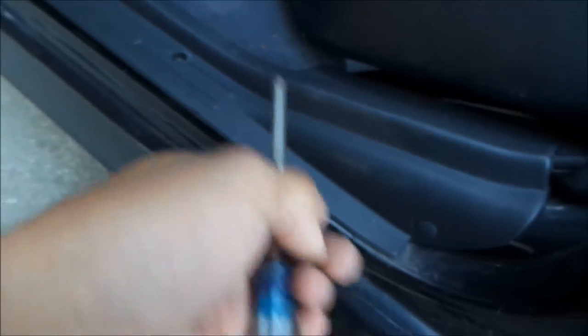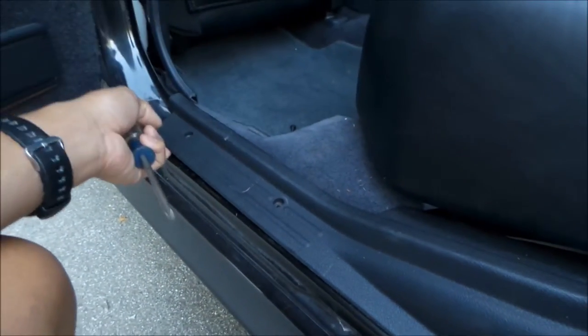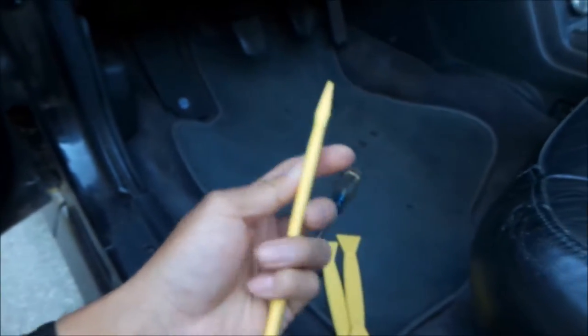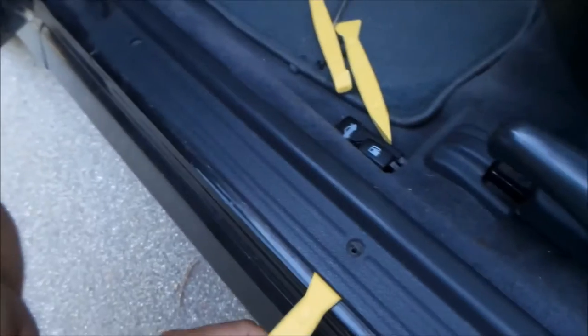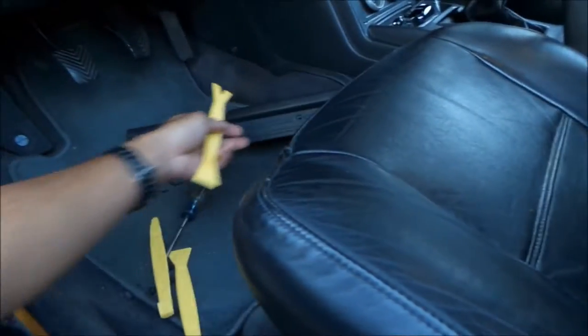So I have with me to do this, I needed a screwdriver. I'm not really sure how to get this piece off, but I'm pretty sure if you pried it off enough, it'll come out. I just got it just enough so I can pry that part off. I didn't really need to take this out, so I just take the screws off here. And then I lift it up on these tools here. This is my interior trim piece tools that I bought from Harbor Freight for $6. They're great, except they're not very thin, so it's hard to get in those really tight spots, but they won't mar up your stuff. Once you get these screws out, same with the back, you just stick one of these in here and then get it between here and just pry it up. It'll reduce your chances of breaking these. I've broken them in the junkyard. They're pretty flimsy.